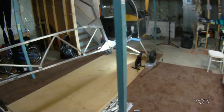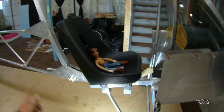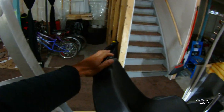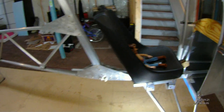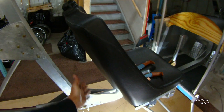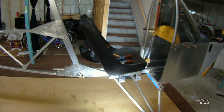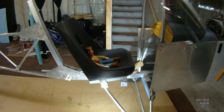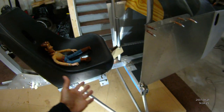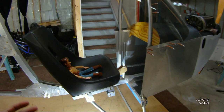Up to the front here, where I spent a lot of time mounting the seat. This is a seat-tank combination — it's a gas tank. Here's the vented cap; it comes from Leading Edge Airfoils. It's only about five gallons, and this thing burns five gallons an hour. I have space back here to put an auxiliary tank if I want to do longer flights. They don't give you any guidance on how to mount this thing, so I came up with a seat rail and was able to mount it so the ergonomics fit me for the way I like to sit and fly.